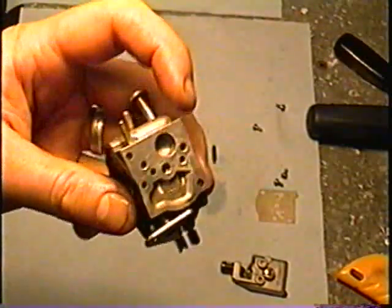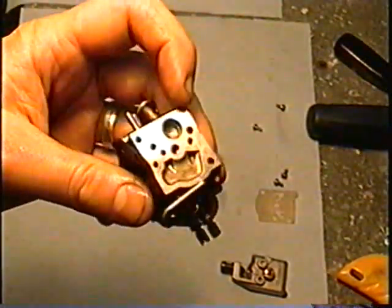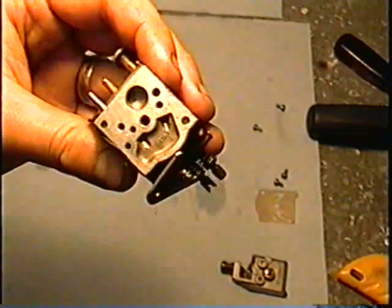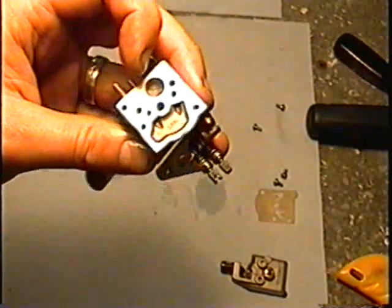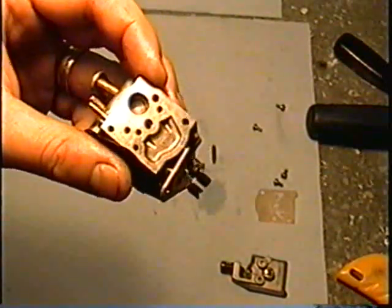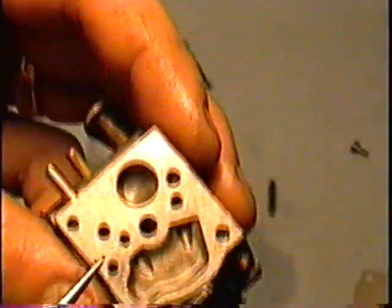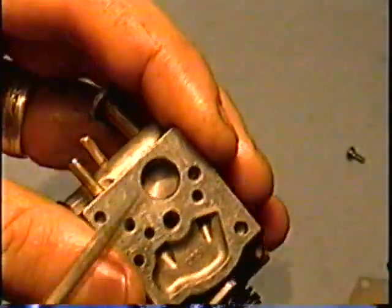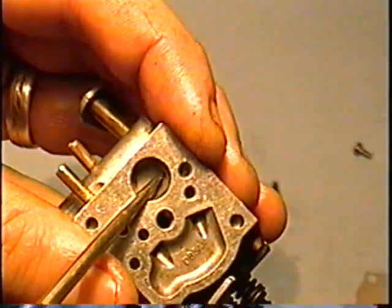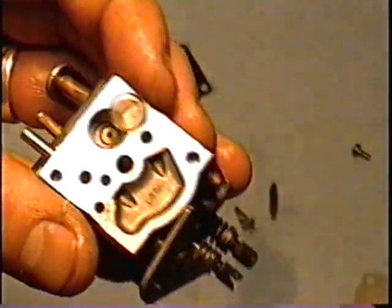On this side there's a little screen in this hole — if you're doing a complete overhaul you may want to replace it as well. It may look clean sometimes, but the gas can varnish and clog the screen even though it may look clean — I've had this problem before. To remove the little screen you may want to get a little pick, sharpen it on your grinder, slide it in gently, pick it, and there you go — it's out.